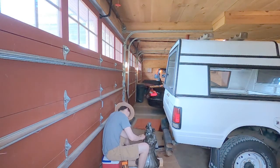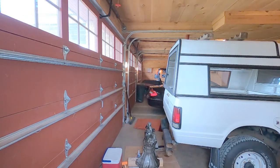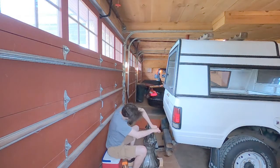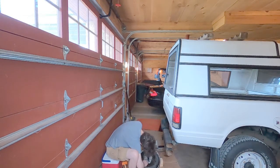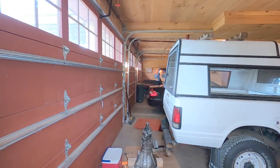My biggest worry about rebuilding this transmission right now, and I'm making this video right after I did this basically, so I still have yet to put this transmission back into my truck. I had taken it out and put a used one from eBay in, and that used one from eBay is really in rough shape. It has no fifth gear. It's a 5-speed, it's the exact same transmission, but fifth gear does not work. Reverse grinds, and there's odd noises elsewhere. I wasn't able also to fully mate it up to the engine block. I struggled with it for a couple days.